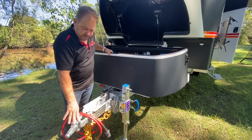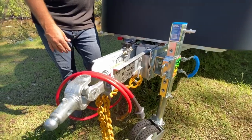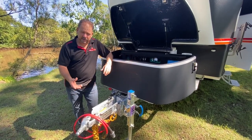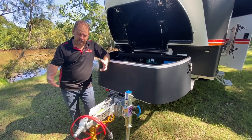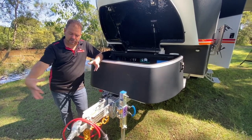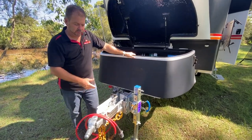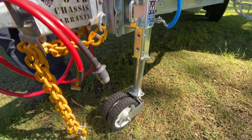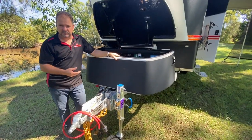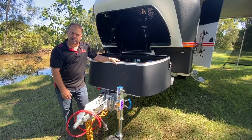For hitches, it's a full off-road hitch — comes standard with the Treg hitch, but this particular unit has the McHitch, which is proving exceptionally popular due to its nickname as a 'marriage saver.' Blokes are able to back it up and get it hooked on without needing to be absolutely precise. The yoke comes in from the front, super simple to get hooked up. The Ark dual jockey wheel holds the front section together, and this unit runs a 3.45-tonne ATM with a drawbar weight of only about 165 kilos.